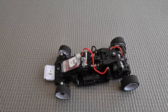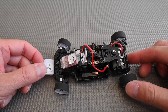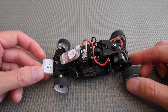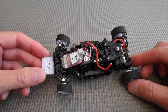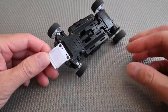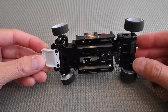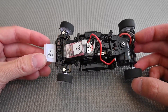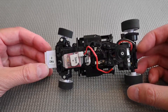We're going to get started with an overview of looking at what types of screws are on different types of cars. Here we have basically an almost stock MRO3 and as you can see most of the screws are the Kyosho self-tapping screws. These are actually crosshead — they're not Phillips, they're JIS — but you can use a Phillips driver for the most part.